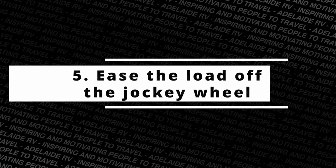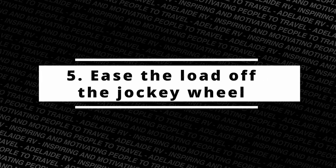Make sure also, as a fourth thing, that your toilet cassette is empty. Empty the toilet cassette and then just put about 300 mils of water in it, put one of your chemical tablets or some chemical liquid into it, and that will make sure it's fresh when you start to use the van again.